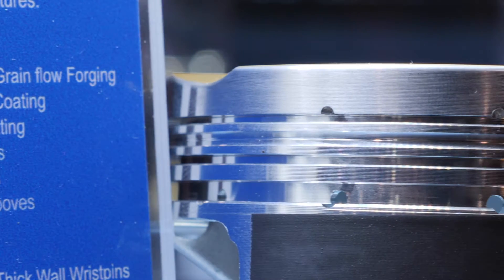By reflecting that heat, do you have any change in piston to cylinder wall clearances? Does it make a difference to how much the aluminium forging will expand? That hasn't been much of a concern, but the other option on the piston — our Perfect Skirt coating — tightens up the clearance and has helped there, so we haven't seen a need for a change in the overall piston to wall clearance. It's worth noting that these ceramic coatings are definitely not a fix-all for a poorly tuned engine; they're not going to hold your pistons together if something goes tragically wrong with your tune-up. That's correct.